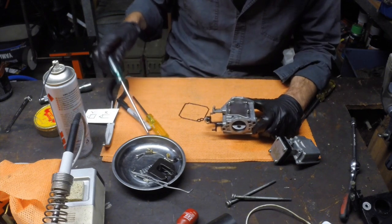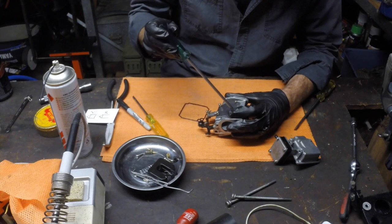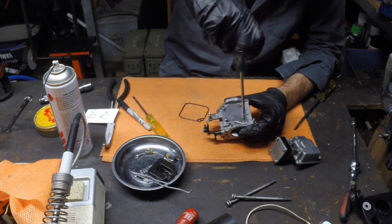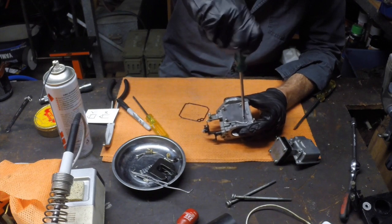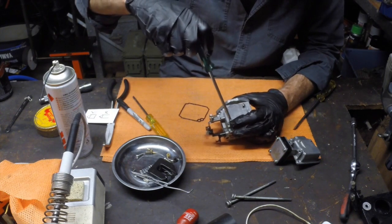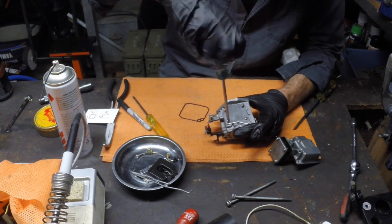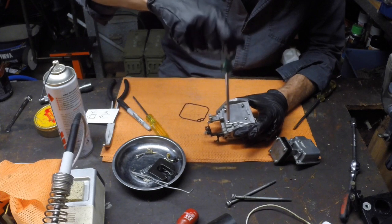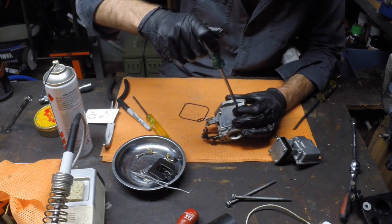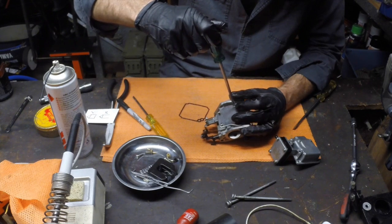The gasket underneath, if that did come away from your bottom plate, just have a look. I mean, it's obviously in this case the top plate. This top plate's got a very distinctive shape, so it's pretty obvious which way it goes. If yours isn't, just have a look at the imprint in the gasket. It'll tell you exactly which way around it goes. There'll be a whole lot of witness marks from all the different ridges and grooves and things that it seals.